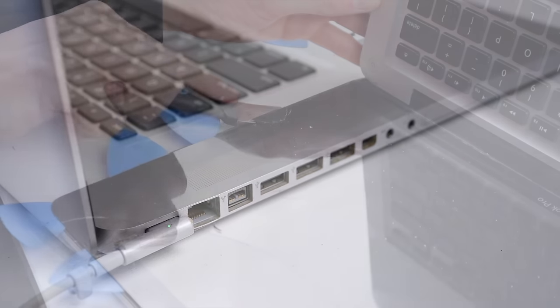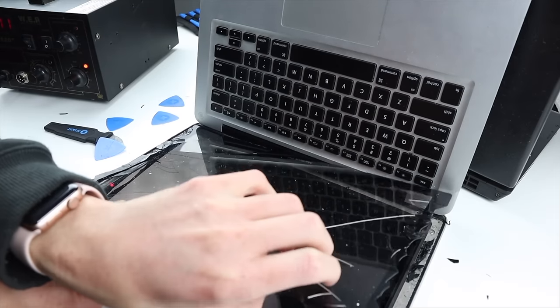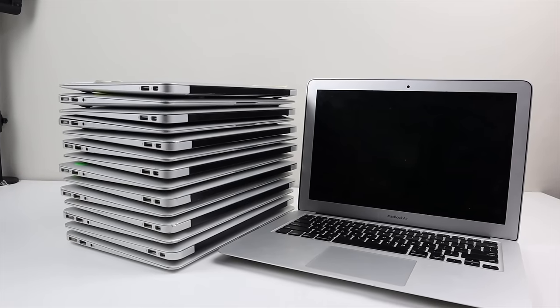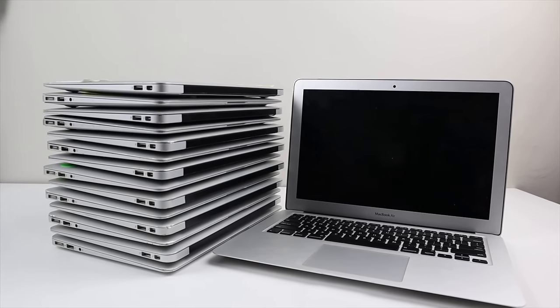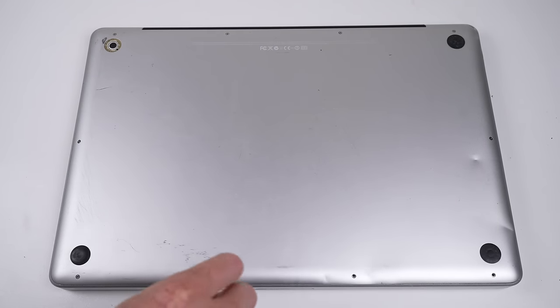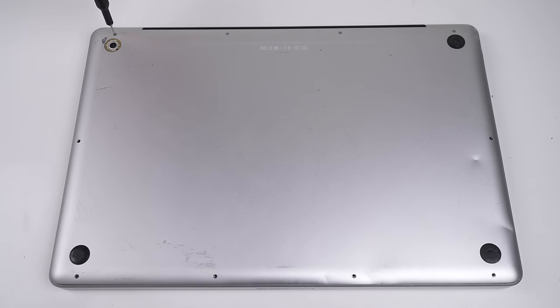Although anything with a glass screen will be greatly more challenging — so much so, I wouldn't recommend this modification unless you're also replacing the display at the same time. This MacBook Pro, like the Air, has an aluminium bezel, which we can peel off without risking damaging the display. The matte screen with aluminium border was a special order at the time, and explains the lack of a glass screen.